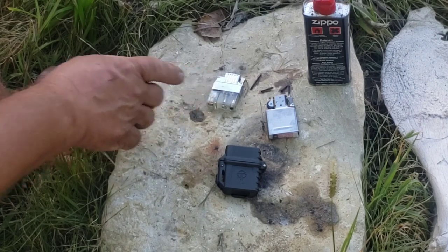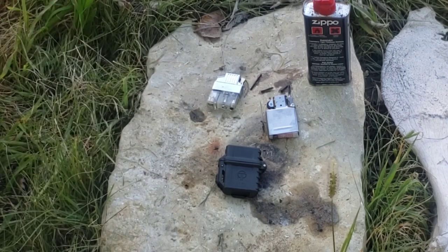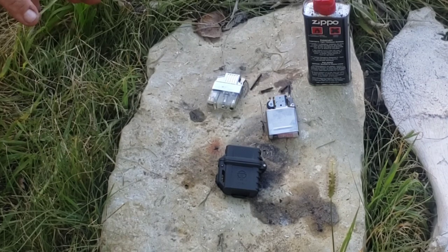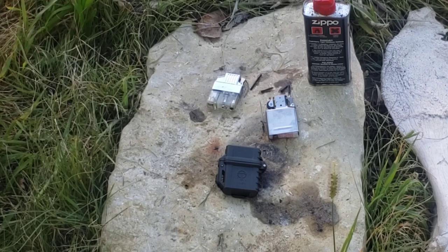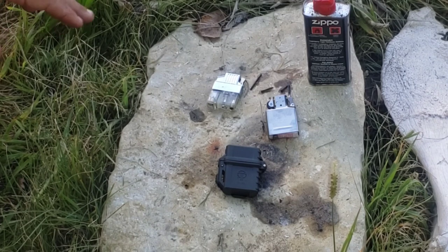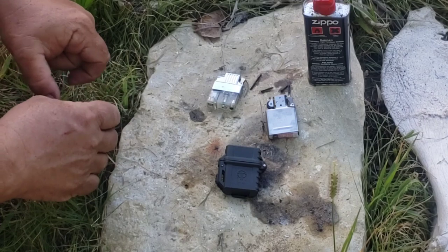With these gas inserts, or any gas lighter, use the recommended butane gas that they call for. Don't go cheap because you'll be buying a new one. It seems like every time I've tried that, most things you do that to will eventually plug up and quit working. You have to use the good gas because it's filtered and filtered and filtered — it's usually triple filtered. The cheap ones aren't.